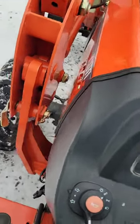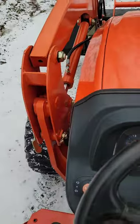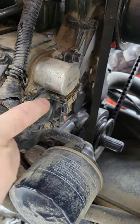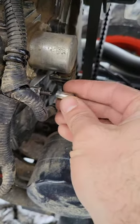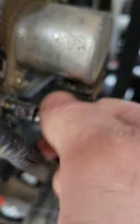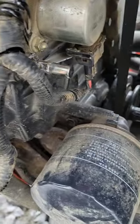The only thing is I can smell more — let's call it incomplete combustion coming out of the exhaust. Maybe I'll back it off a little bit, maybe one and a half turns instead of two, but definitely worthwhile. So to wrap up, I did a little bit less than two turns. I re-tightened the jam nut so this thing's not wiggling around — now it's locked into the location we set. I saved the original piece; granted, it's got a piece missing because I ground that off when I went too deep. Put this on and tighten that up. That's it.